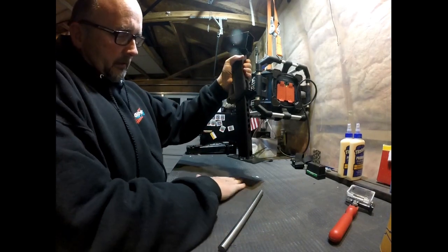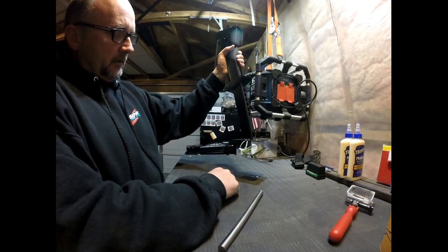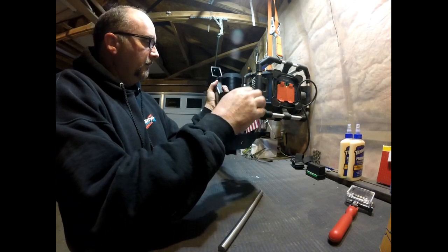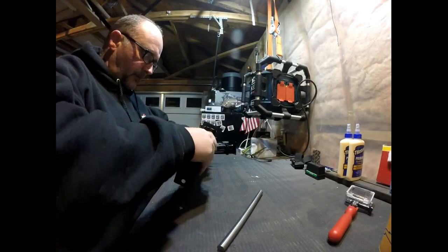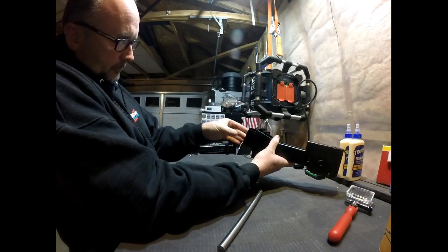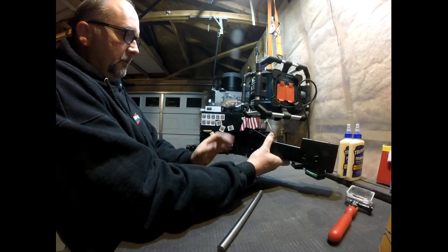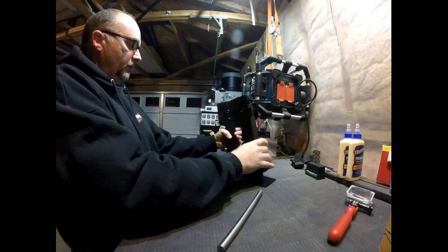You know, putting pressure up on your trailer, forcing the nose down, and then stabilizing the whole thing. So I'm going to need another 3 or 4 inches till mine even touch the ground. Of course, I could just put some jack pads in there, which would be nice. But I think what I might do is just create some spacers and weld them right on here. So when this thing is all the way collapsed, it'll just be a little longer. You know, I'll weld some square tubing or something and put a plate on the bottom of that, just to lengthen them. So there's 2 of them, and they both look like that.